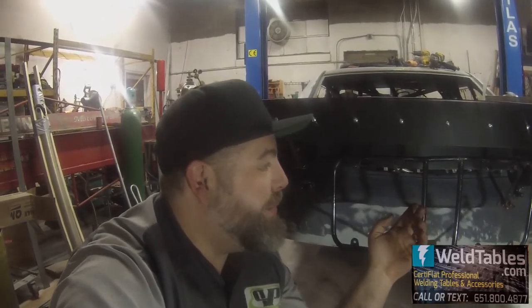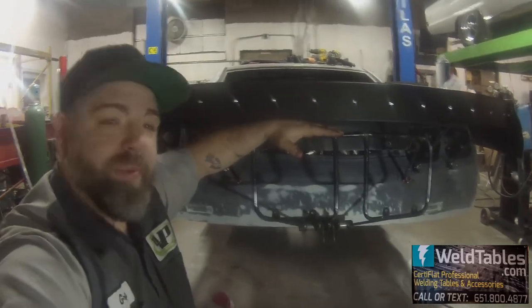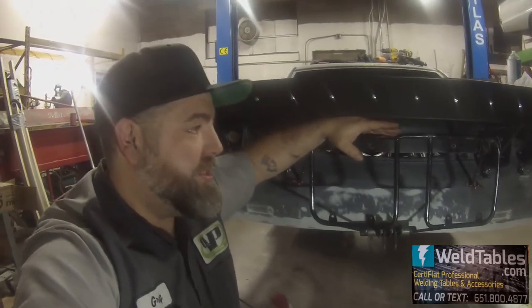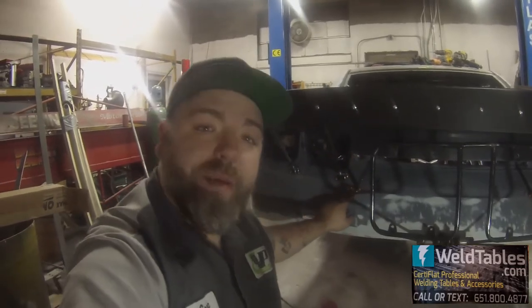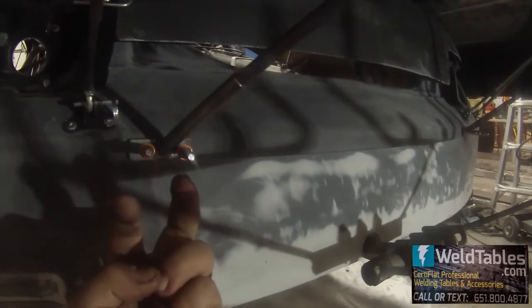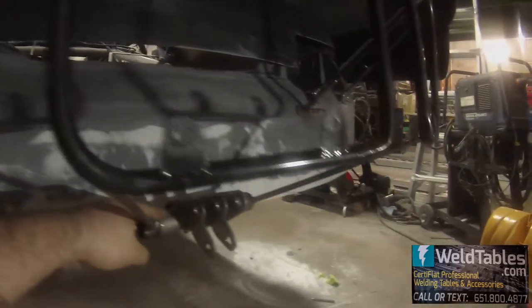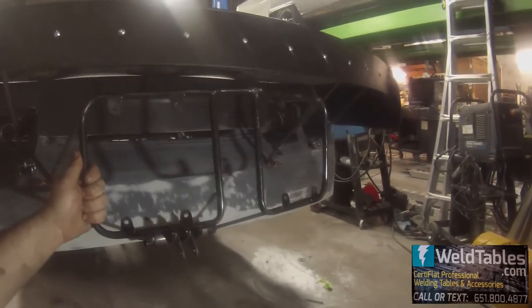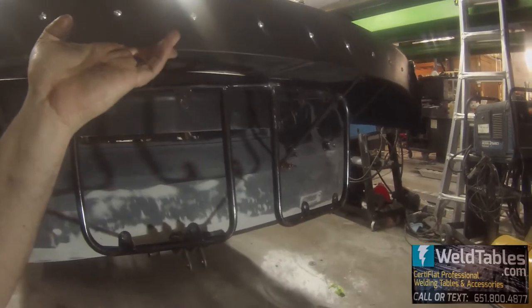At the back of the car, we were working on this before and now we've got it all welded up and finished. We're going to sandblast and repaint this. What we have is a dual parachute mount at the back. The parachutes actually hang up a little bit from this, so it will actually be an extra support for the wing — it hangs about an inch to an inch and a half off of there. There's a backing plate inside; it comes in, holds the supports up, and then it bolts down below. The thing is super, super sturdy, and it'll act as another support for the wing.